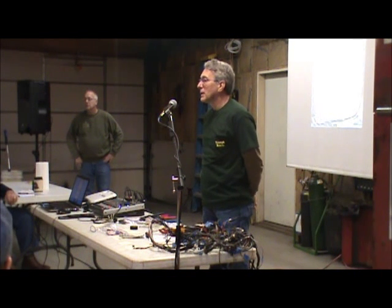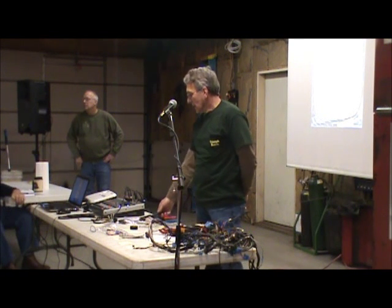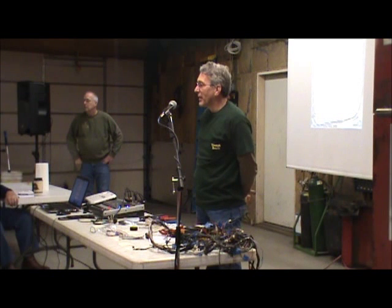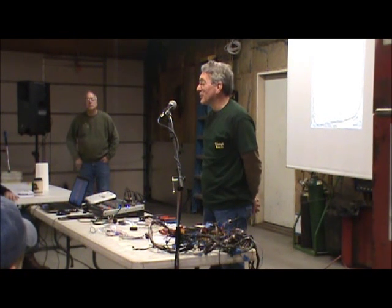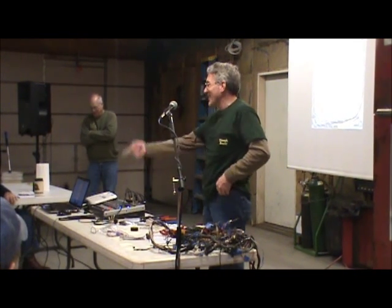What I did about 35 years ago, I put a toggle switch in the back of the glove compartment that locks the glove compartment. And I wired the ignition wire through that switch. When I'm in an area where I want to shut the thing off, I just pull the switch. To me, a master cutoff will drive someone nuts trying to find that cutoff. Yeah, I've run into that where I was trying to get a car started and I couldn't figure out why it wouldn't start. And when I finally broke the car apart, oh, look at this. That's what that switch is doing.